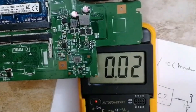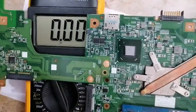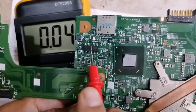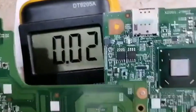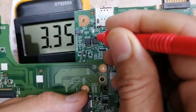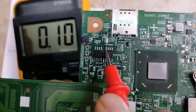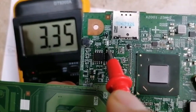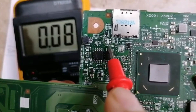After that we should go directly to the BIOS. Here we have the BIOS — always put the black probe on ground. The BIOS is bigger than a MOSFET. Always locate pin number one through eight; pin number eight of the BIOS should hold 3.3V. A bold or thick line connected to a ceramic capacitor means that IC is receiving power.